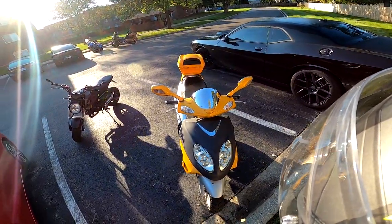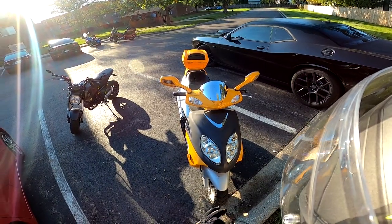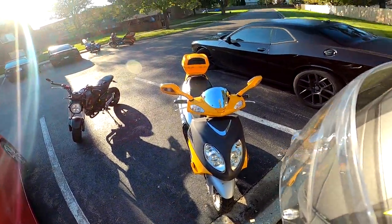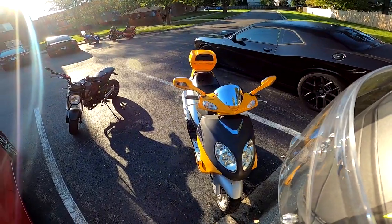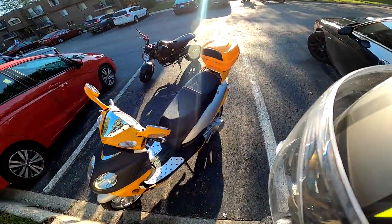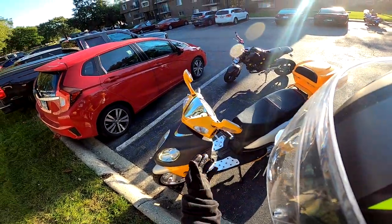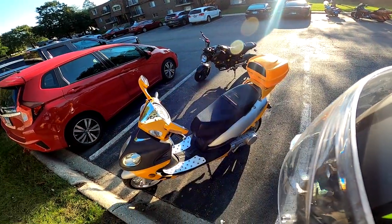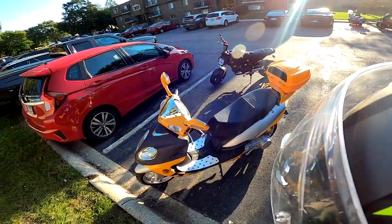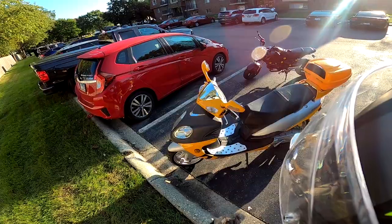When you ride this thing the lights are very dim, and sometimes they work; as you speed up they get brighter. That's basically a voltage regulator issue. The stator is like an AC generator, and just like everything else that puts out AC, you've got to turn it into DC — that's what the rectifier is for. It's basically a heavily packaged bridge rectifier: AC comes in, DC comes out. I did some searching and I think the regulator on this thing is toast.